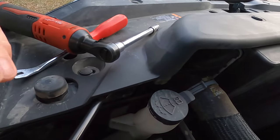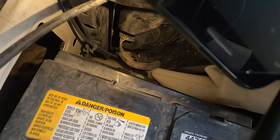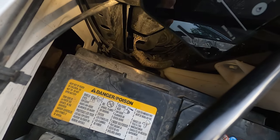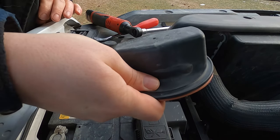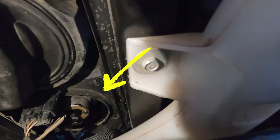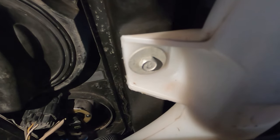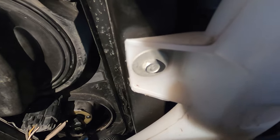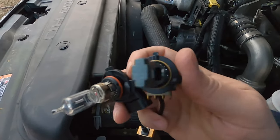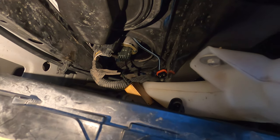These are plug and play so you'll just want to order up the right size for your vehicle. On the Silverado there are shrouds that you turn to take off — you turn them and they pull off, and the lights are behind that. They're actually marked: one side's up, one side's down. The bottom one is off and the old bulb is in there. It's as easy as untwisting that bulb, disconnecting the harness, twisting the new bulb in, and connecting the harness. You want the LED to be positioned straight up and down in the housing. Now I just need to connect the harness.